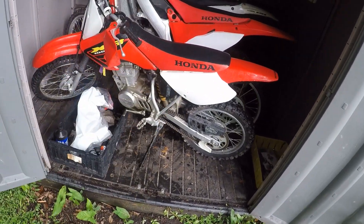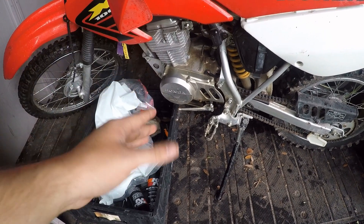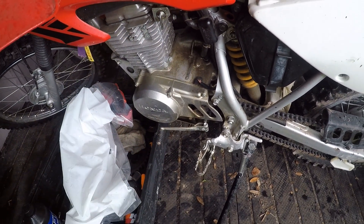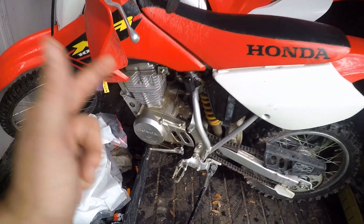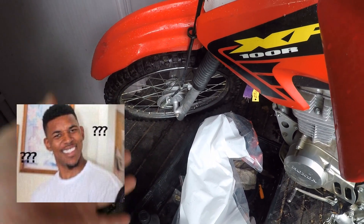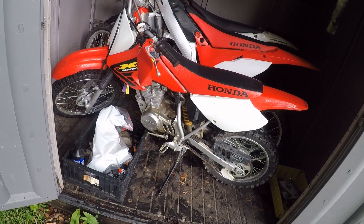Alright guys, gonna have to end the video right there - it's starting to rain as you guys can see. Sorry I'm breathing heavy, I just had to throw three bikes into a shed and it's starting to come down hard. As you guys could tell, the XR100 is running lean. It's not idling correctly because we're having to run it on reserve and it's not getting enough fuel to even make the idle adjustments correctly. You don't want to run a bike lean or you'll end up blowing something up. So we ordered a petcock valve - not OEM but it was like 10 bucks - and I ordered a front inner tube. We'll get those installed and then start doing our pit bike adventures and wheelies. If you like this video give it a thumbs up, comment, subscribe, and check out my Instagram - it's the same as my YouTube without the G in 'riding'. Thanks for the support, see you guys next time.